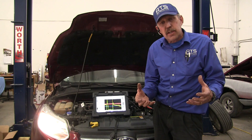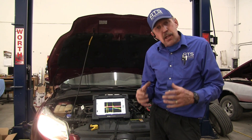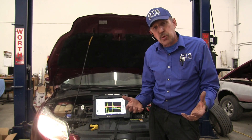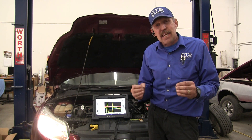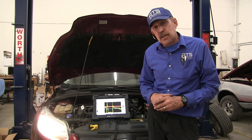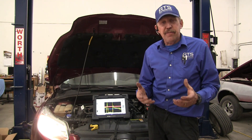The code for this is sort of confusing because it says it can't obtain reverse gear — but this doesn't have to do with reverse gear. This is the clutch. If you follow the diagnosis, you'd be looking at something wrong with the transmission or the module, when this is actually a clutch problem. It's pretty crazy that when they know this input shaft speed sensor is in rotation, they did not give us a code for that. These transmissions are just really different and hard to diagnose because of the way Ford presents the data, but these are tricks I've come up with that I hope can help you.